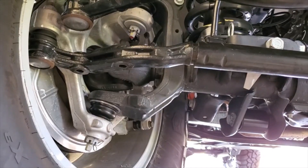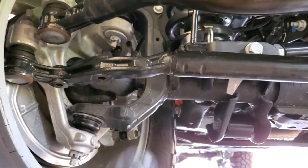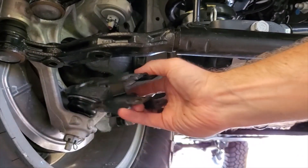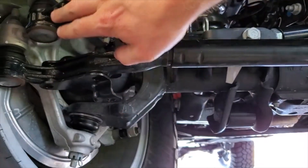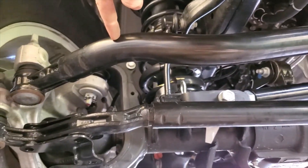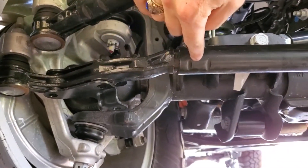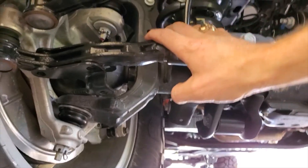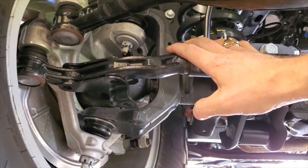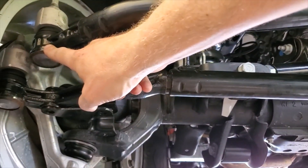I had to turn the wheel to the far right to get these two bolts out. This bracket sits in there sandwiched, so to get the bolts out you have to get your drag link out of the way — because it's all connected at the knuckle. Awesome design. The older Jeeps were connected down low, and once you lifted the Jeep it messed up all the triangulation. You don't have to worry about that anymore, and you don't necessarily even have to do an alignment after a lift on these Jeeps because they're separated at the knuckle.